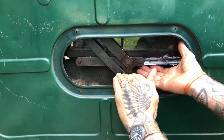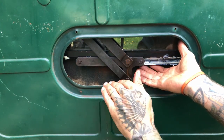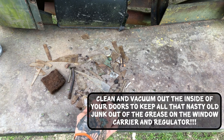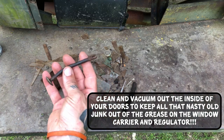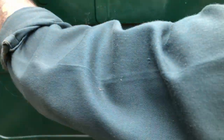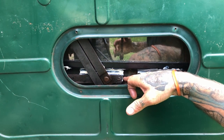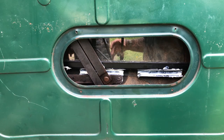I've never installed a D-series window before, so we're learning together on this one. I'm going to lower the window to the point where it detaches from the regulator, then turn it just a little so it's not at a point I can't pick it up. I cleaned out this door before starting because there was a ton of broken glass, mouse nests, and all kinds of stuff — I found the doorstop, which is usually missing on these trucks, along with old channel clips and part of an old door latch and lock, all twisted up. So this door has had a hard life. We're just setting the window on top of the pins of the regulator — I can feel it sitting down about an inch from where it was. We should be able to put these felts in real quick and get this back on track.